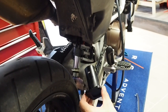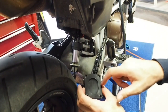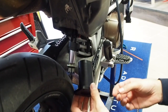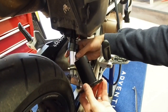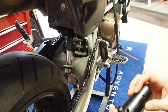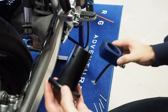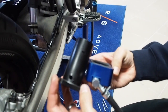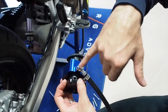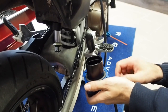We need to connect the auxiliary tank with the OEM tank. Here, in the bottom, there is a cover and holder of the fuel pump. So you release all these four bolts. Make sure that the tank is dry, otherwise you get a lot of fuel in your hands, which is not really pleasant. Then you see here are these small two hooks — they are here and there. You take a small screwdriver to be able to release it out. Next operation is you need to drill here a hole diameter about eight, nine, ten millimeters. The more important thing is that it is actually positioned against this outflow. So either you do the mark before drilling like this, or you put it on, you take a small drill, you do a small mark inside, then you drill again. Helpful if this is flexible, not tightened.